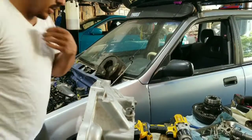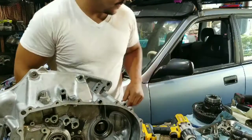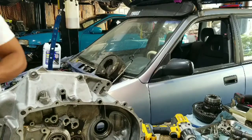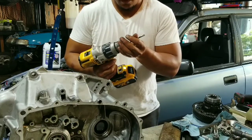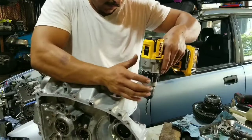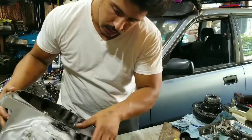So now I left off at tapping that, so that's exactly what I'm gonna do. I'm gonna drill a hole, then start to tap. Just tap right here. Drill bit is there. Then I'll have me a bolt just so I can chase it after I'm done drilling. And since, like I said, I'm not using the size that would normally come in it, I'm using like a 10 mil. You just have to go centered. It doesn't have to be exactly centered. And you should be able to go all the way through because there's nothing back here. So that works out perfect.